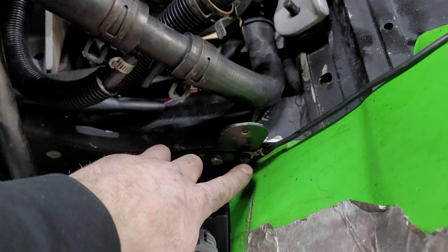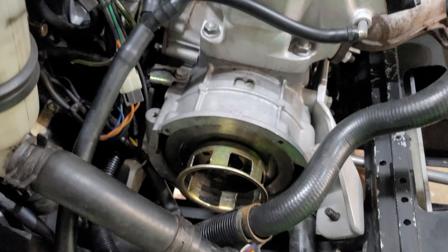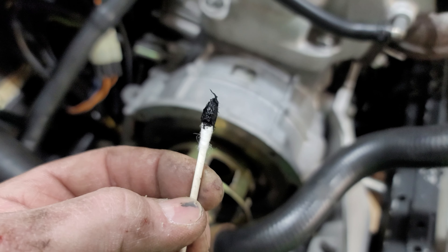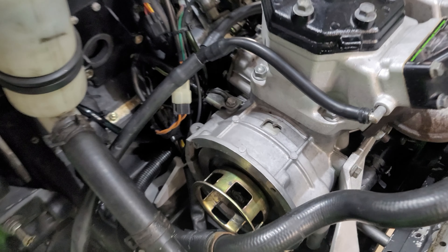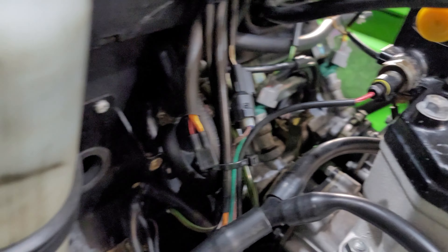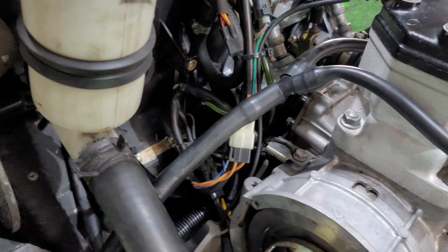The last thing to put in there is the servo for the power valve cables, which has its one plug right there. For the stator, I made sure to use my carbon conductive grease. I realize this stuff is more for a mechanical connection, but it helps either way — if it's conductive, it's going to keep the connection protected from moisture and it's going to be conductive.